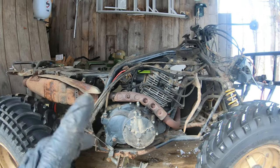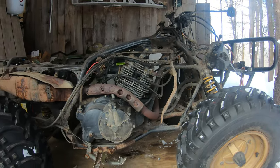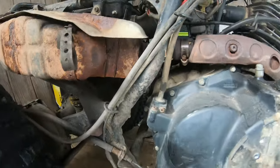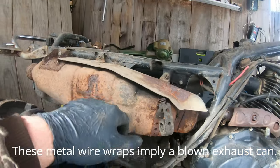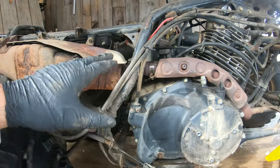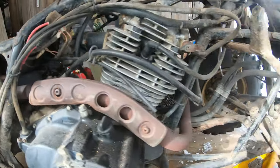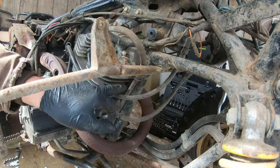We have the back plastics off, we have the front plastics off, we've lifted off the tank, disengaged so we can see the motor here. So what next? I think one thing we're going to want to do is take the exhaust off, brush it, check it for holes, anything of that nature. It's really kind of stripped out on some of these Allen bolts - we'll try and break those out. There's always a project to try and get the exhaust off the head on something old.